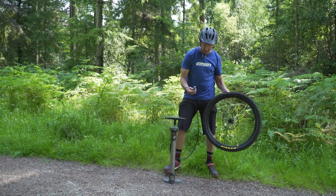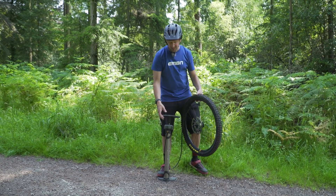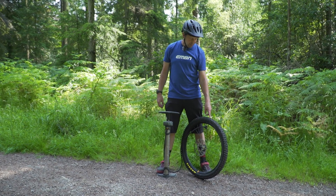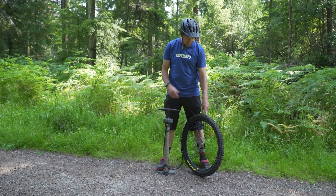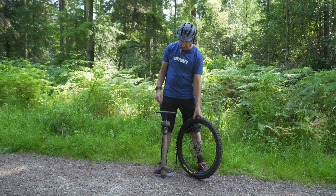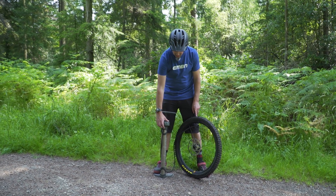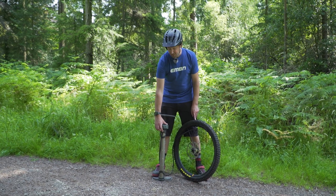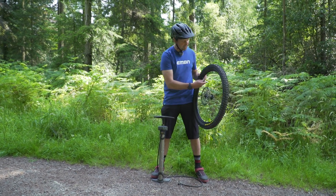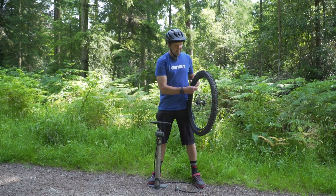The chamber's all charged. I'm literally just going to connect it up, lock that on, just flick a switch, and it inflates the tire for you with no problems. You might hear a few pops and bangs as that tire locates on. It's just dropped to 40 psi, so it's a little bit hard. It's okay for my style of riding, but if you're going trail riding, you can adjust that pressure on the front of the pump to get it to bang-on pressure. Then you're good to go, as easy as that.